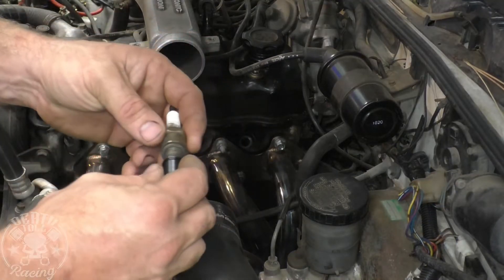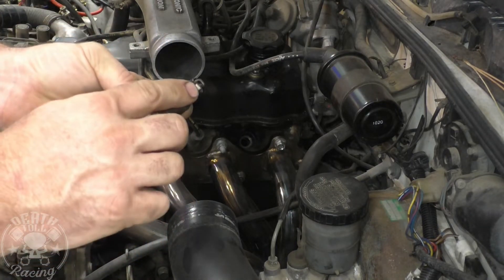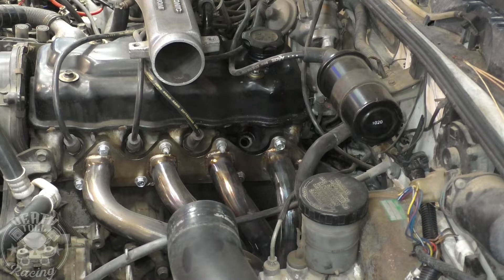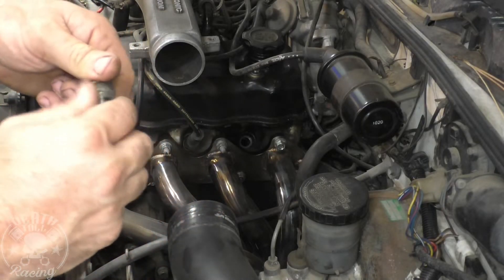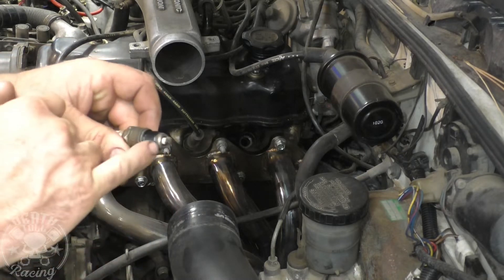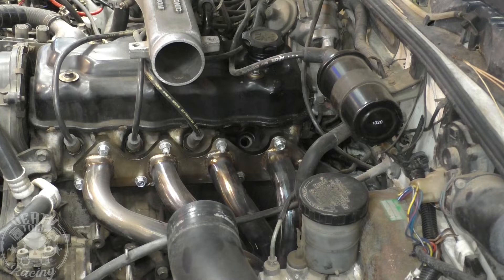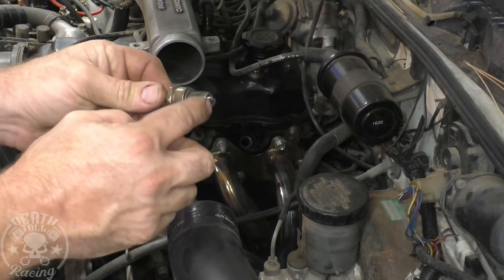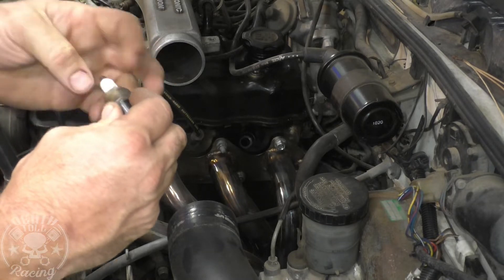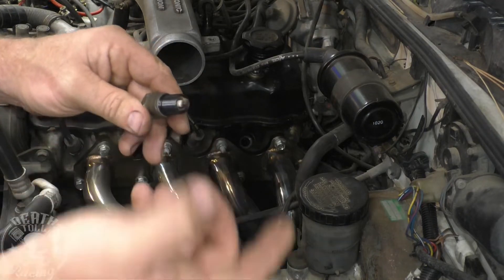You can measure the hole or just measure the spark plug itself. I'm checking that the insert tube isn't too long. The longest one is maybe a little long, the next shorter one is a little short, so I'm going to use the long one. The reason is that when you go to remove the spark plug next time, carbon will have built up on those threads, and you'll probably pull the insert out instead of the plug. As long as it's not sticking out beyond the electrode, we should be fine.